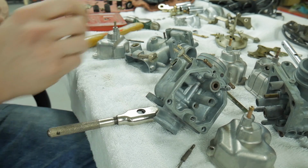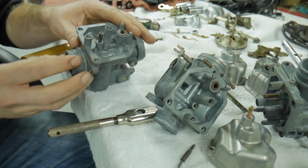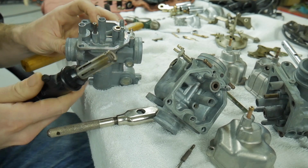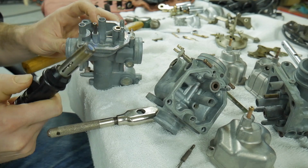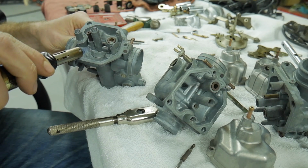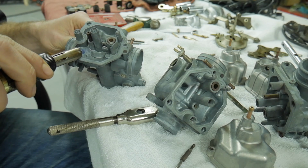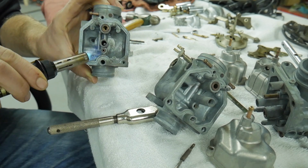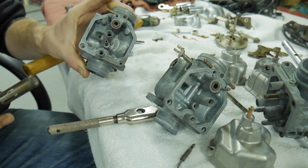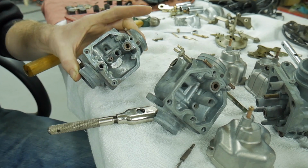In other cases, what you can do is find the jet that you're trying to access, grab a little bit of some heat, okay, a little torch action, and I would just heat up right at the base of where that metal is. Not for a long time, just give it some searing action going on. And that usually helps a lot. Heat is your best friend when it comes to extraction.